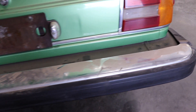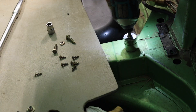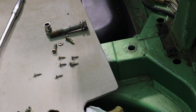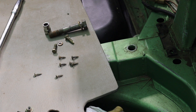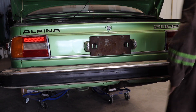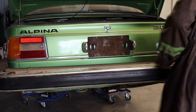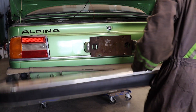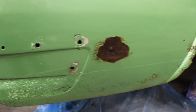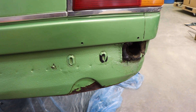Now it's time for the rear diving board. This unit is huge. You have three big bolts to remove off the back — one is hidden in the middle under a plastic cap — and on either side you have a few 10mm bolts to remove for the rubber trim, and the bumper should come off. Once off, you can see the plugs used for the euro bumper holes.